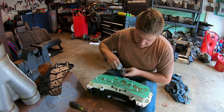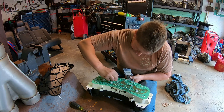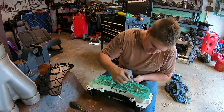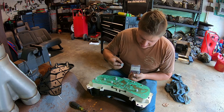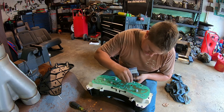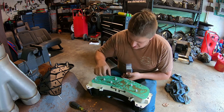Okay, got that off. No damage, no harm. And then we have all these little guys on the back here — these are all your backlight bulbs. So I have new ones. Twist them out, take it out, and then the new one twists back in. Just keep in mind you are dealing with a printed circuit board here, so again, be gentle. Now that I have these out, I will go through and test them to verify which ones are burnt out and which ones are not.